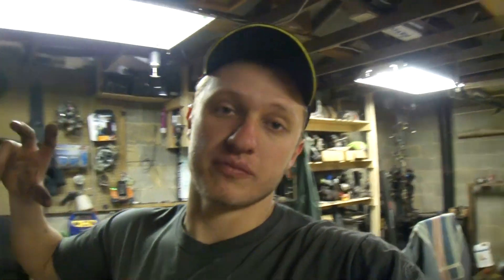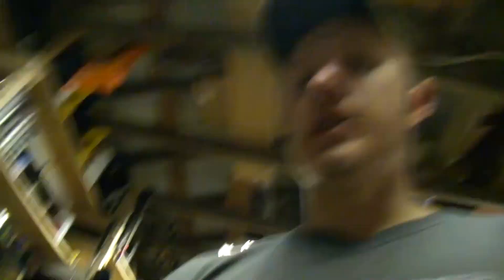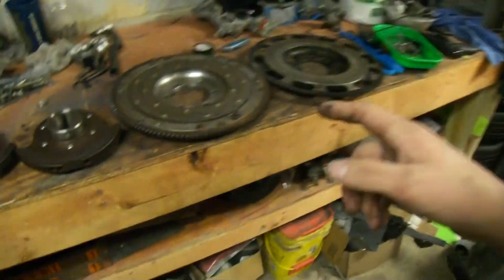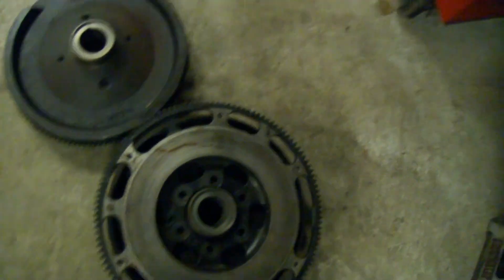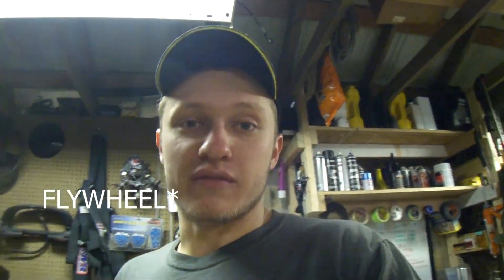The bell housing is bigger or smaller, the starter is different and in a different location, so you have to have the right flywheel for that. You can't run, say, a 12A flywheel in an RX-8 trans — you need the big-diameter flywheel. Here's the difference: it's about a half inch bigger overall in every direction. These are both NA flywheels and you can see it's noticeably bigger. There are people who've successfully drilled and mounted a turbo 2 or RX-8 starter at an angle on an NA setup, but I've never done it — check the forums if you want to try.